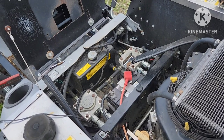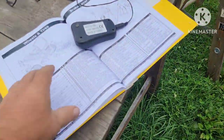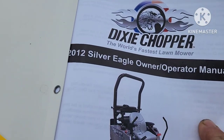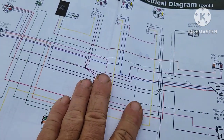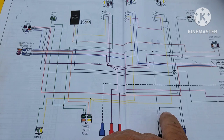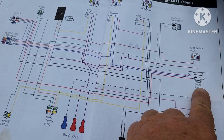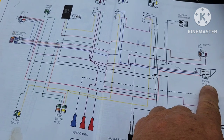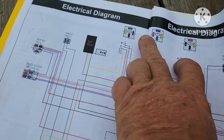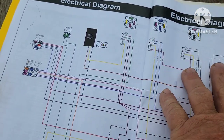However, we could not run the mower deck. I got it back here, and I do have the Dixie Chopper 2012 manual with the wiring diagram. Unfortunately, this does not contain the engine harness, which I guess is a Generac thing, and it does not label these relays. The relays are under the key switch, but it doesn't label what they're for — they appear to be some kind of safety.